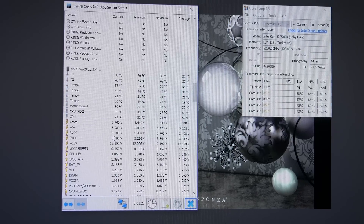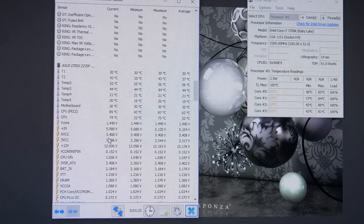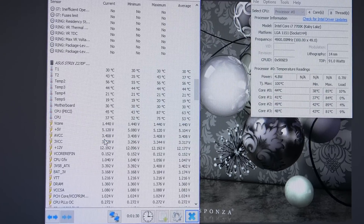Here it is doing Cinebench at 5.2GHz, and I actually edited and rendered this whole video at 5.2GHz with no stability issues whatsoever. I made the switch to this CPU from a 4.6GHz 4790K, so I have around 7-10% IPC improvement alongside a 500MHz boost and faster DDR4 RAM — it was not such a bad deal for me. Let me know what your Kaby Lake CPUs are running, whether you're delidded or not, and thank you for supporting this channel by subscribing. See you next time everybody, bye bye.